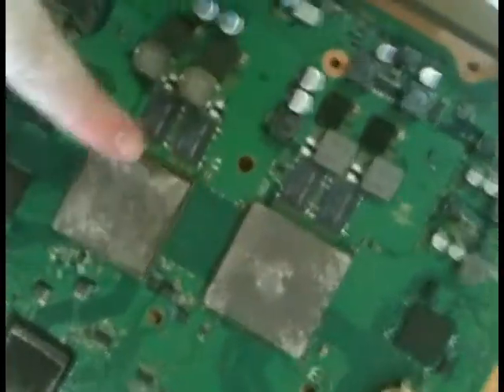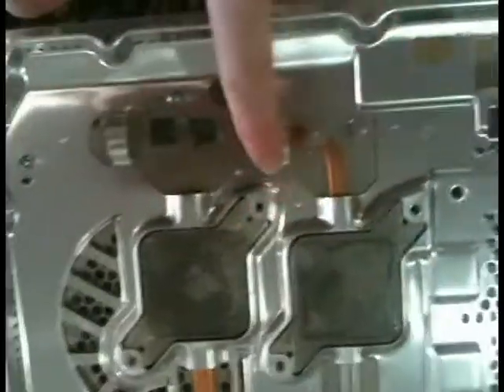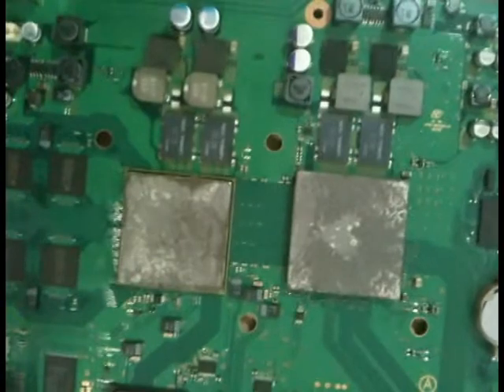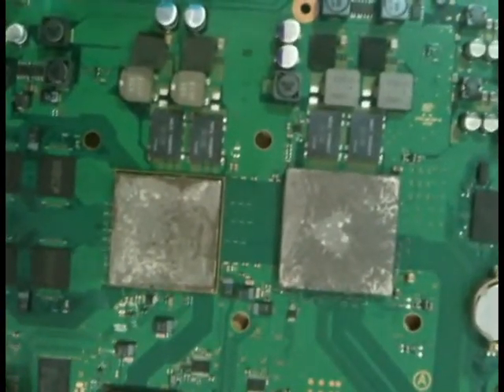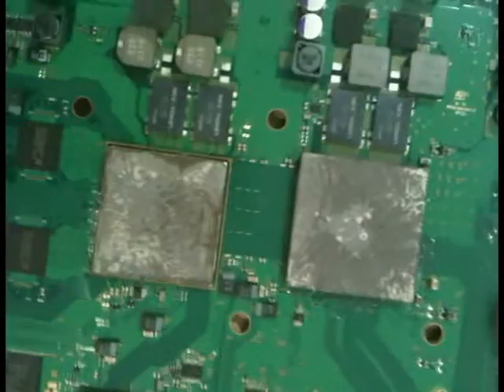You can see that's the stuff that I'm talking about, bound over here to the heat sink. Now this is the heat sink itself — you can see the copper pipes that carry the heat off the processors and over to the fan. I've done this a couple of times and reapplied all of this heat sink compound. You're actually going to have to do that every time you do this operation. Go to Radio Shack or some kind of computer supply store — I recommend the Arctic Silver 5. It's the same kind of stuff you'd use building a PC to put a heat sink on the CPU. It helps conductivity because metal on metal doesn't conduct heat so well. We don't actually need to take this apart further for the operation we're doing, so we're done with this unit.